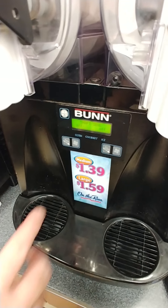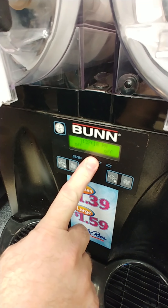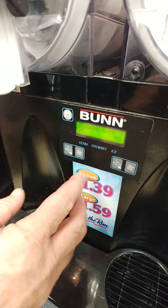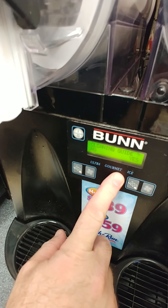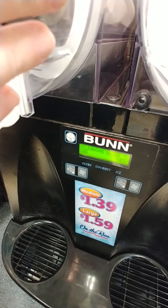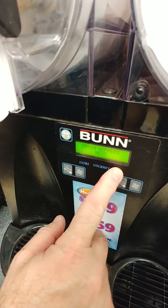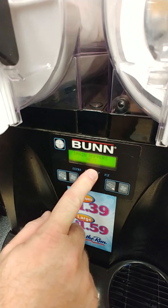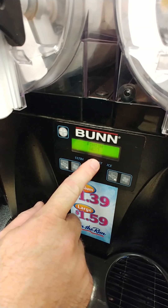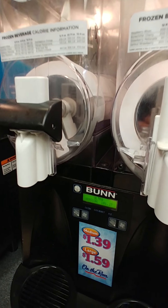Now since we have the machine reassembled, we need to reset the error message — it's showing shaft seal maintenance due. To get into programming, hold down the gourmet button until we get to programming mode. The first thing that pops up is the cleaning guide. If it was giving a clean due today message, you have to go through this to reset that clean message — and you have to do it at the end of maintenance when the barrels have warmed up sufficiently, otherwise it will not reset. Go through the cleaning guide to reset. It gives you all the steps on what needs to be done. When you finish, reinstall and refill the product, hit finish next, and then it reboots. Then we can get back into programming and reset the shaft seal maintenance error message.